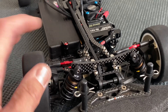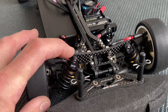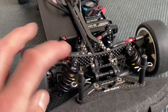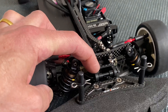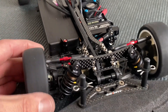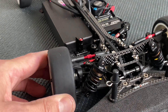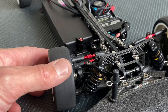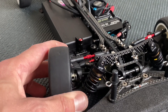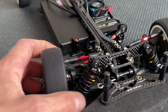Looking at the front of the car, you can see a few new things: the lower front shock tower with shorter shocks — about 3 or 4mm shorter — which helps the overall center of gravity. Because of the thinner shock tower in front, we also have a carbon brace in soft and medium types to tune the flex of the bulkhead. We also have a new line of springs — the SMJ — with a full range for the short shocks: linear springs from 2.6, 2.7, 2.8, and progressive springs like 2.5-to-8, 2.6-to-9, 2.55-to-8.5. In the end I used the 2.5-to-8 in front — that's the yellow one.